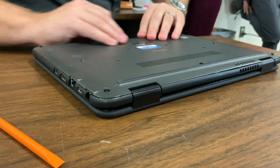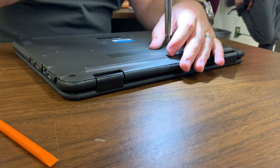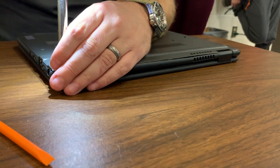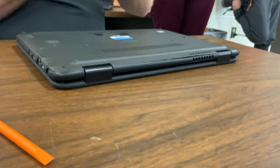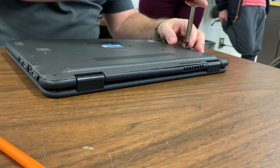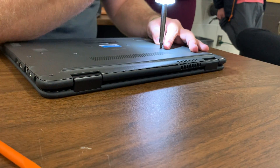Question: are we not supposed to take the keyboard off using the spudger? No, we are not supposed to take the keyboard off with the spudger. Doing it the way I showed you is much cleaner. You can do it with the spudger, but it's harder because of the way those little holes and notches are set up — it grips it, and if you're pulling from the side it puts a bend in it, making it more difficult to actually pop up.